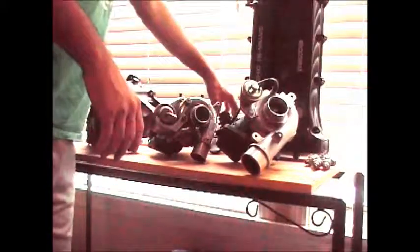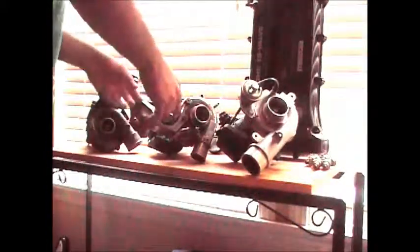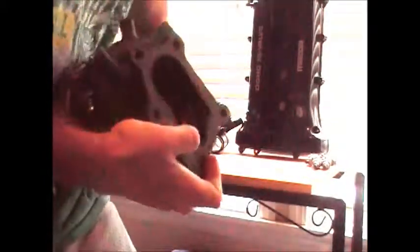So, basically what it looks like is, you can see it in this one. Here in this K04 here, off of Mazda Speed 3, this little door, that's the wastegate. See, it's really hard to move. I can't move it. Anyway, this push rod is activated by vacuum, opens up this little wastegate, which takes a lot of pressure to move because there's a spring inside the solenoid, and that's what lets it out.